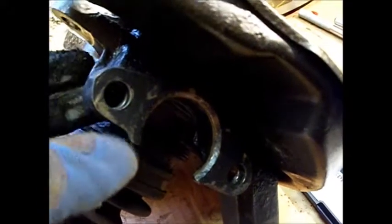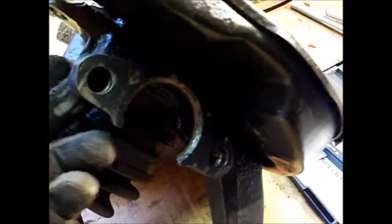What we're going to have to do is re-thread this so that we can actually use the bolt. We have to move one bolt size larger because the threads are stripped for the smaller bolts. The standard stock size here is 12mm, and we have to move one up — the next metric size is 14mm.